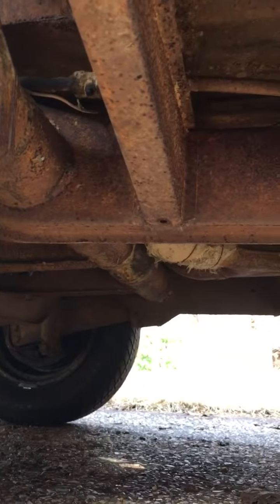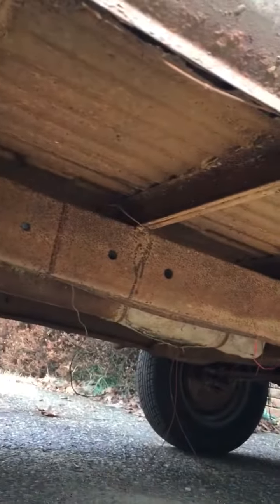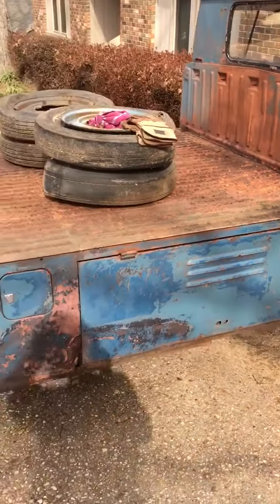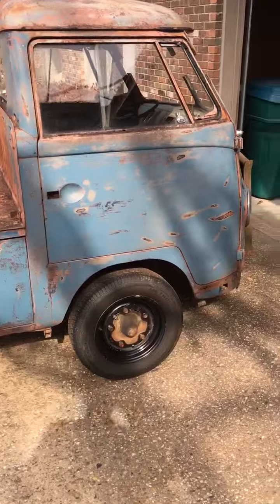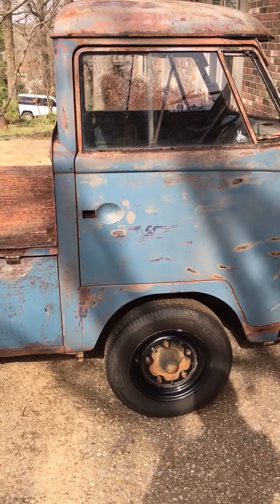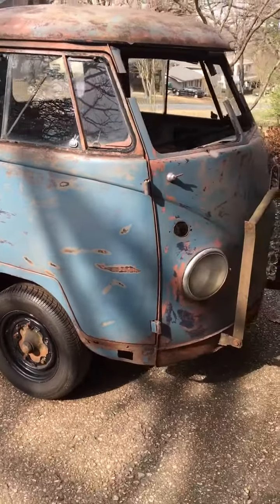The frame from what I can tell is solid. Looking pretty darn good — not too toasty. A little bit of the tubing installation still left. Some of the jack points are kind of torn up; the other side's got a little bend. You can see some rot along that lip, but all looks good — '59 single cab. Plans are to put some power on the back end of it, address the brakes, replace all brake lines, hard lines, master cylinder — just do all the brakes and steering components, see what the center pin looks like.